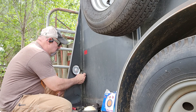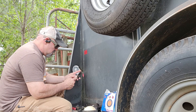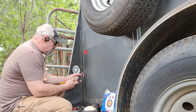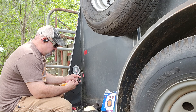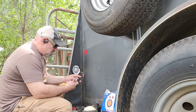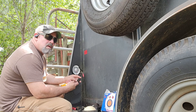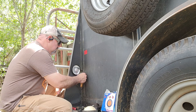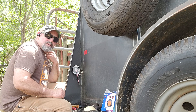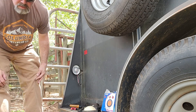Let's see if we've got a good ground on here. I'm going to test the test light to the ground that the trailer has. All right, you can see — that'll be your brake and turn, and that'll be your parking light. Turn the parking lights off, let me see if this power goes away. The power didn't go away, which means on the trailer wiring it's actually connected to the battery positive. So I'm going to have to drop that connector down and switch it to the terminal for the parking lights.